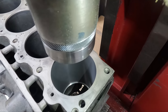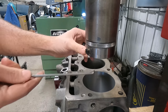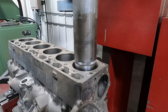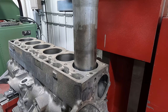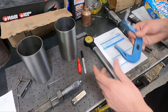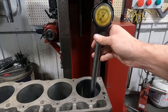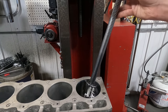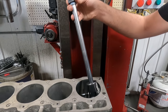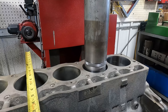You can see the step at the bottom — roughly three-sixteenths of an inch. For the next step we'll pop out the rough cutter and get the finish cutter installed to bring us to our finished parent bore size for that precise press fit. With the bore gauge zeroed to the sleeve size, we're measuring right at 2 to 2.5 thousandths press at the bottom and around 2.5 to 3 thousandths up higher — about the same in both directions. With that confirmed, we'll repeat the process on cylinder two to get it ready for a sleeve as well.